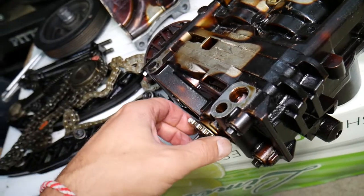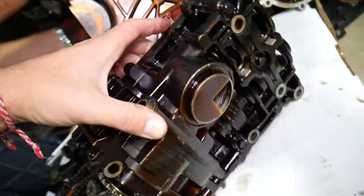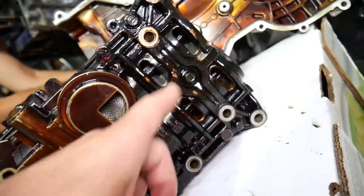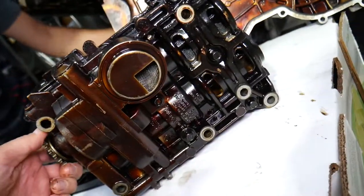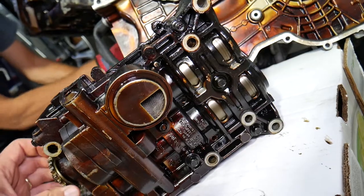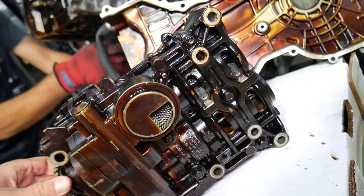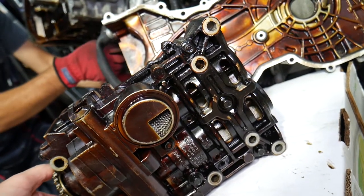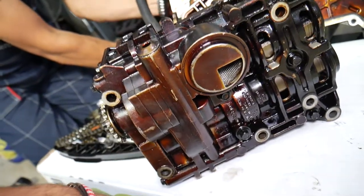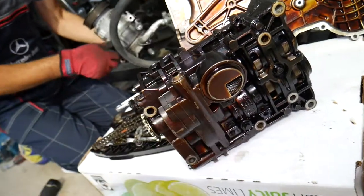This is your oil pump — and it also has the balance shafts and counterbalance shaft built in. On the side you can see the oil pump screen, which is where the oil pump draws oil from in the oil pan. This is the counterbalance shaft, and if you spin it you can see the two big weights that move to balance everything. Putting it back together is practically the reverse of how we took it apart. If you have any questions, please let us know. Hopefully this video was helpful — thank you for watching, and see you guys next time.